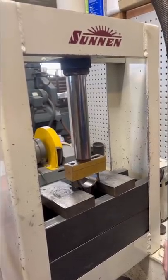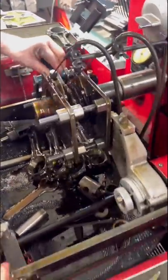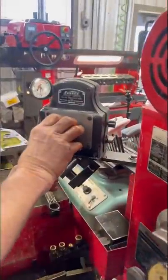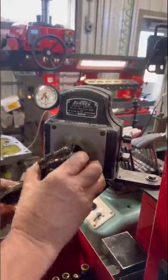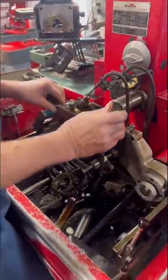For the next step we'll get the bolts pressed into the rods and get the caps back on, torqued to spec, so that we can move over to the rod hone. At this point the diameter of the bore is actually smaller than it is from the factory, but the honing machine allows us to gradually remove material so that we can hit that precise specification.